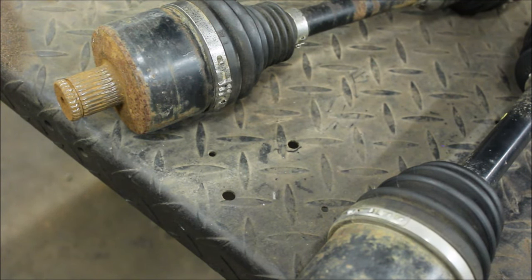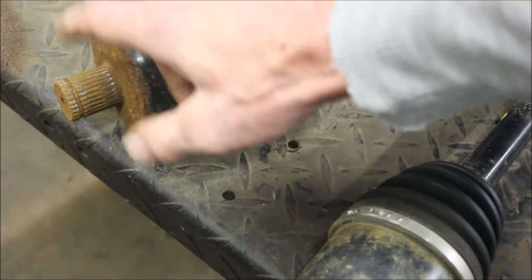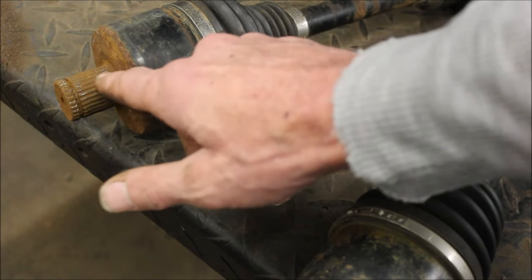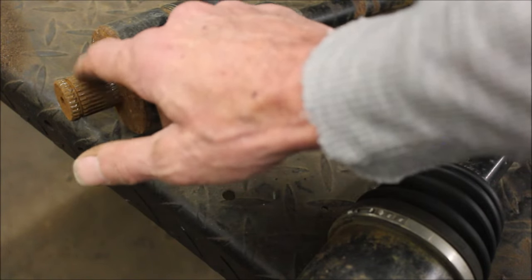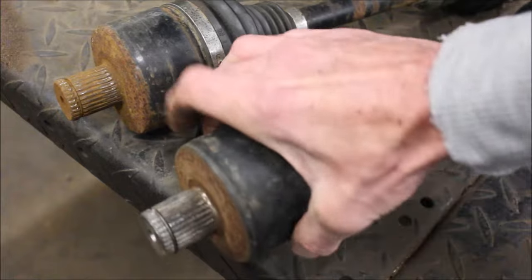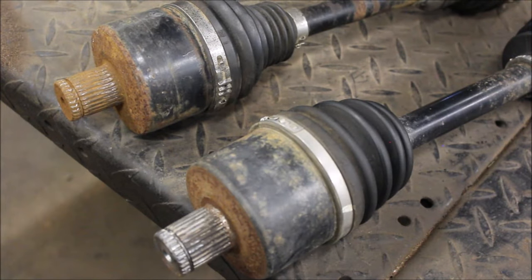I don't know why, if you were in turf mode, it would put so much pressure on that axle shaft that it would actually burn up the splines. My only thought is, this thing was probably used on a farm, and the guy was doing some towing. He did have a plow mounted to the front of this. I mean, did he have it in turf mode while he was plowing? If he did, he was an idiot. I don't know what the cause is, but I'm going to go ahead and throw that back in.